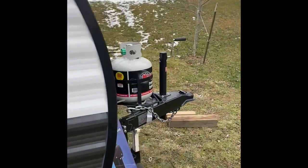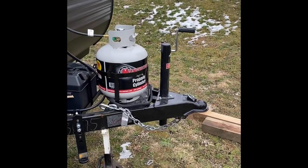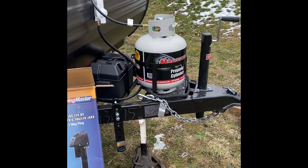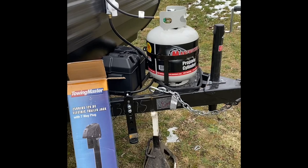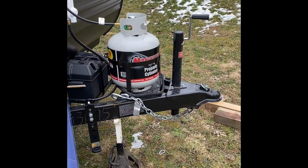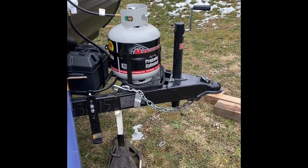As you can see, I've pre-prepped. I've got the trailer tongue level. I've got the jack all the way up. I have a lift underneath the tongue holding the tongue up off the ground. The next thing I'm going to do is grab a wrench and remove the old jack.